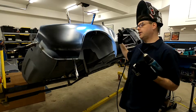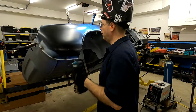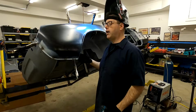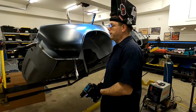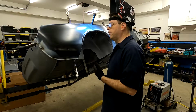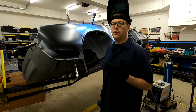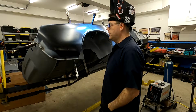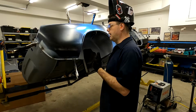And I was showing, in case you had seen me come along with a drill and do that at all, I was scratching the weld-through primer in the hole I want to weld. The whole idea for that is if you laid it on too thick, or if you're using some product that doesn't have a ton of zinc in it. I found in the past with another brand I was using, it was hard to strike an arc through the weld-through primer. So two things, you don't need to make it super thick, you just want that coverage.